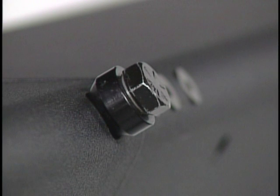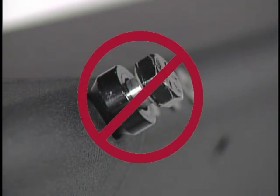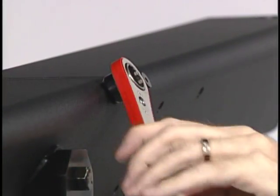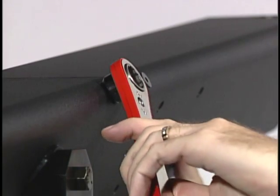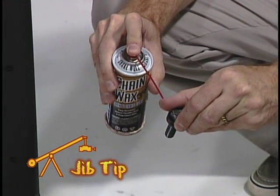Make sure the tapered collars are flush against the bolt head and not extended down the shaft like this. Don't over-tighten these plugs, just make sure they're securely snug, and it helps to keep the threads lubricated with motorcycle chain lube.